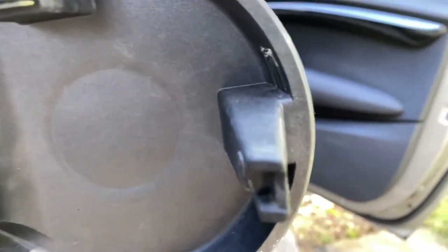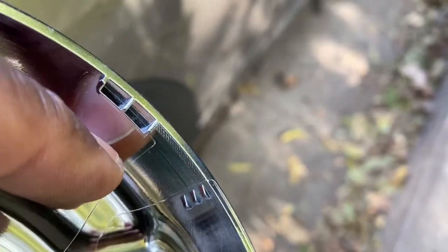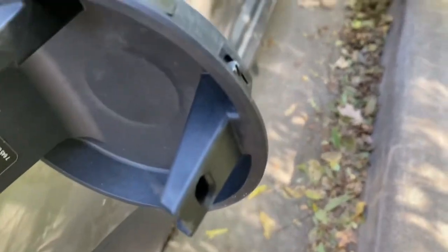So this is the gas cap opened. As you can see right in there there is a little notch, and from the outside you can see that's what we're looking at there. So you have to pry that open. How it attaches to the cover is right here — those little three serrated edges that clip into that notch. So once you pry it open you can just rotate this anti-clockwise and it will actually pop off.